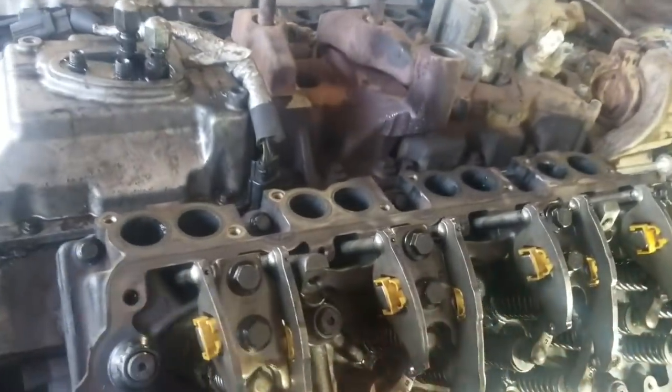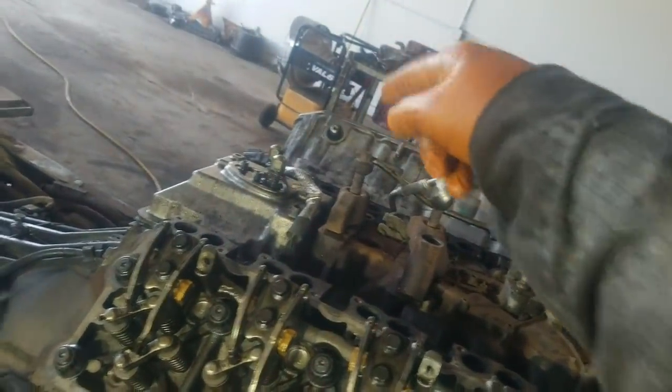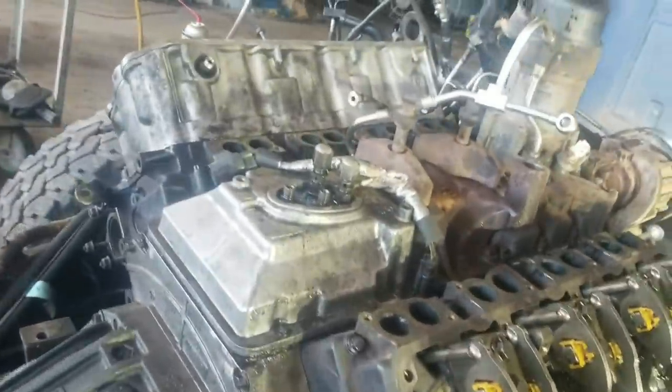So what you want to do is go around. There's a dowel pin on the crankshaft there. Put it at the 10:30 position. I know I'm on number one because that's where I wound up the last time. And the way you tell that is, so this is number 1357-2468. Driver side is 2468. Odds on the right, evens on the left. Which is odd.